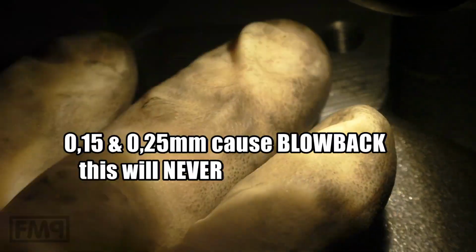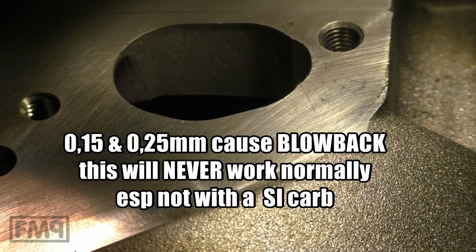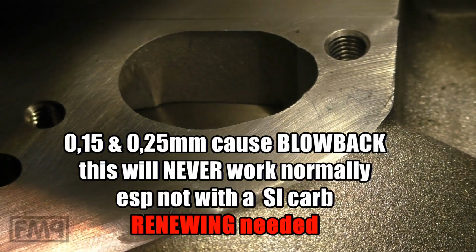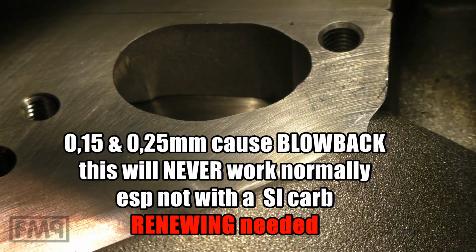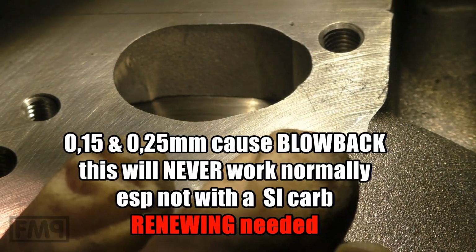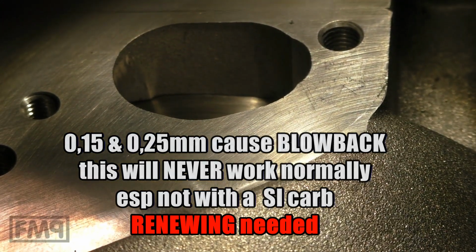It means that we need the rotary valve pad redone according to the crankshaft we want to use, because these both parts are defining the rotary valve, and with 0.25 and 0.15 that's not gonna fly. We need 0.05. Yes, this is little. That's very little. It's less than 0.1, but engines from the factory do have less than 0.1. Of course, very self-explaining. This is what we also need for tunings, isn't it?